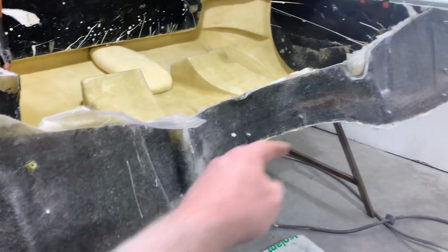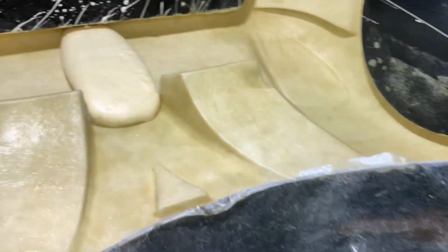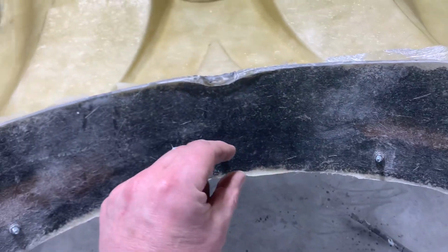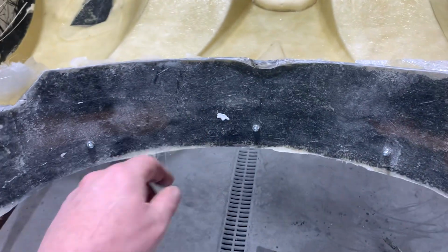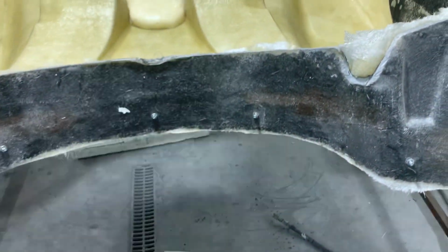So basically when we're trying to open the front clip and we're lifting it on the corner here, we've got that twist motion into that. Also, this corner here, I tend to put a bit of rope in the corner here and make this a bit more thick. Otherwise you end up cutting this back to miss the body. It becomes very, very thin, and you can easily put a twist into that. So if you add a little bit of fiberglass rope in the corner and fiberglass over that, or add some structure to there, it also adds to the ability so it doesn't twist quite so much.